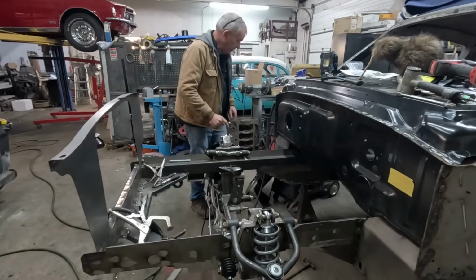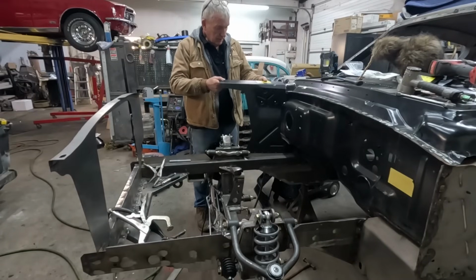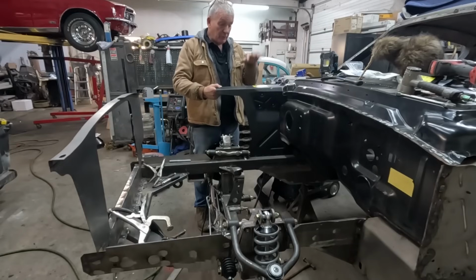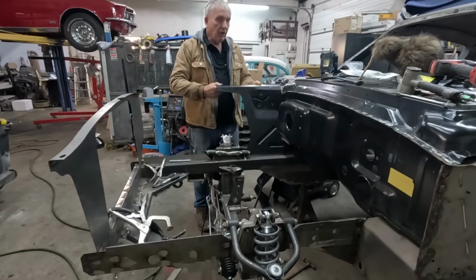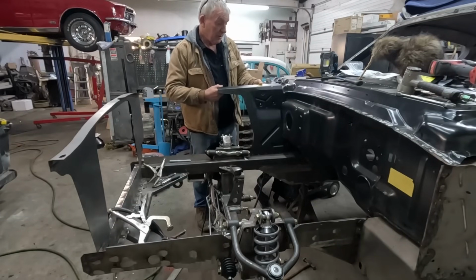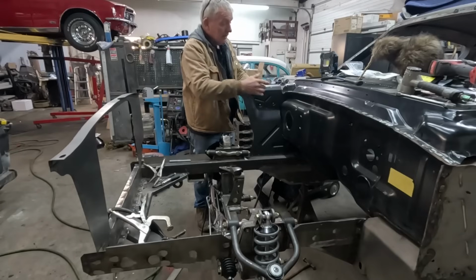Now it gets tricky. Now the really jigsaw puzzle part starts, because we've got your rear inner apron, inner fender, which has got to go here. Now that can go anywhere from there to there, which, as you can imagine, is a dramatic difference when you've got to bolt your fender down onto here. Also, this can go this way. Obviously not that far, but I'm just trying to demonstrate. But eyeball tells me it's going to be about there-ish. But if you're out by half an inch, then suddenly your hood hinges bolt to here, so they've got to be in the right place.